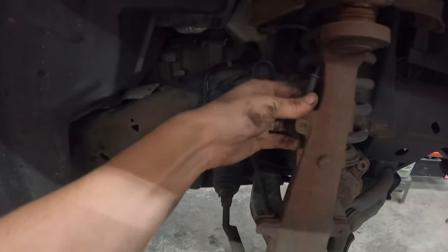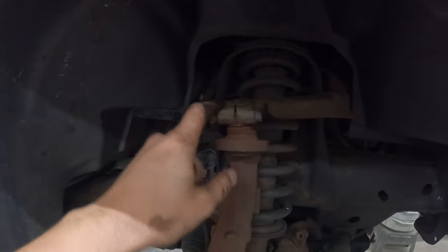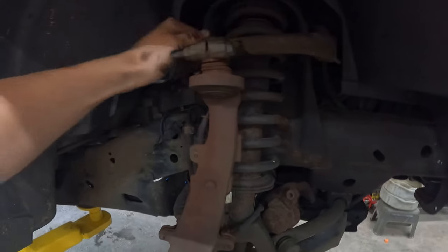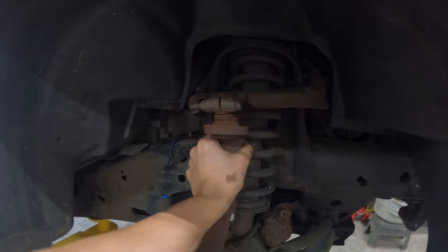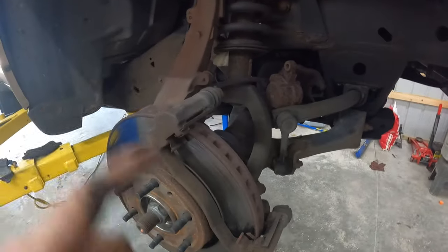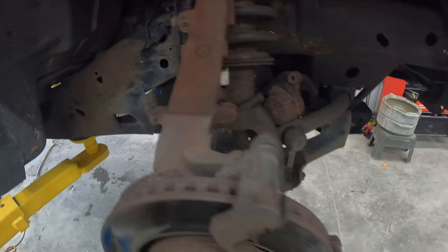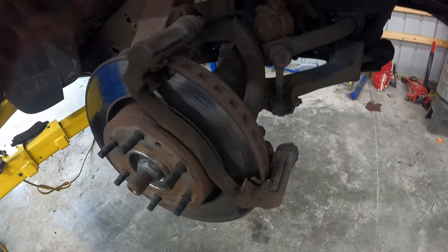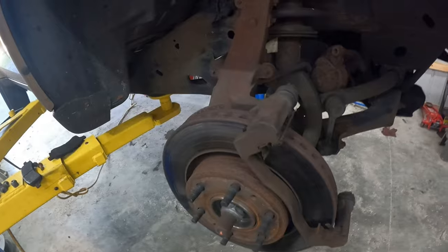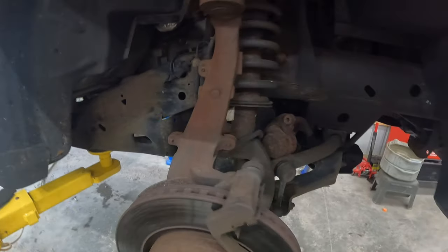And then I'll go through and kind of free up my ABS sensor some so that I got slack. Then we'll unbolt this ball joint, which again, you can see that's not safe. Then we'll try to get that pressed out. So wheel off, 13 millimeter, get the caliper bracket off, 10 millimeters, get these two out. Hopefully it'll come out. Everything's pretty rusty on here. I was gonna take this cow bracket off, but it's being really a pain, so I'm gonna leave it for now. There's plenty of meat on the pads. The rotors are fine, so let's keep going.